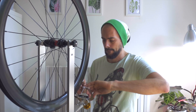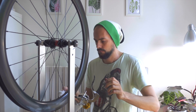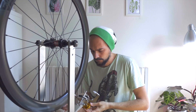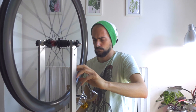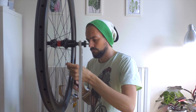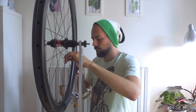With some tension all around, I can start to check the dish to make the wheel centered. I tried to dish and true at the same time on this phase — a lot of boring checks left and right. Essentially it's not that difficult: when you need to move the rim to the left, tighten the left spokes and vice versa. In the first steps you can tighten by half a turn each time. The more tension you have on the spokes, the less you need to tighten to get movement.